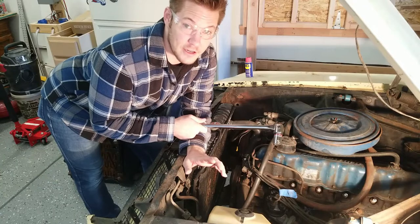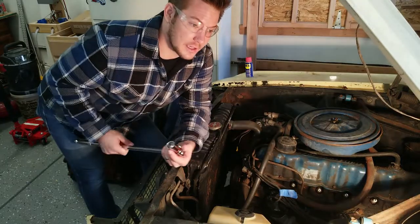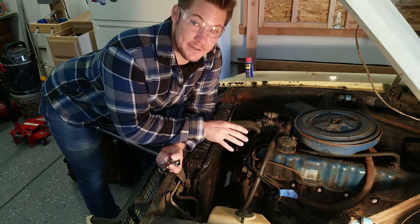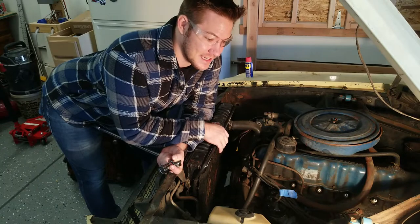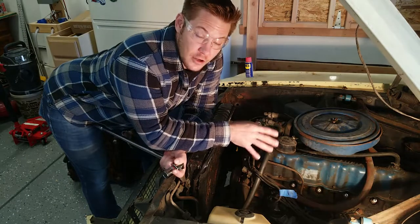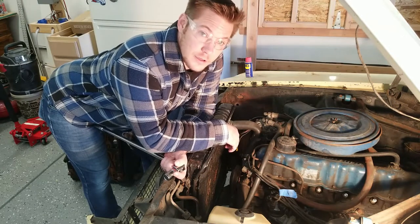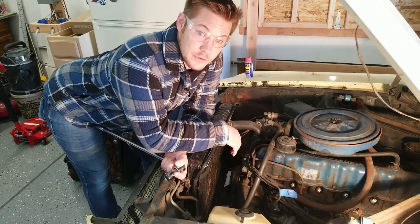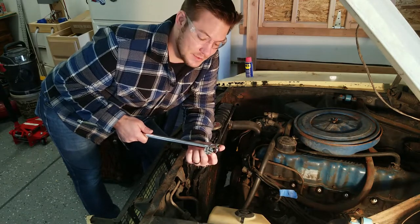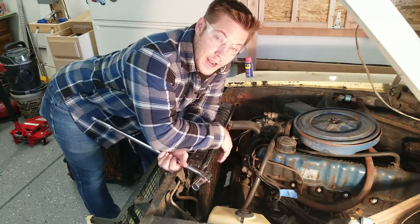So we got the fan out. Now we're going to try and see if we can get the main crank to turn over and free up these cylinders. On the 1968 Mustang straight six, the main crank bolt is a 13/16 bolt size. I highly recommend you get a 13/16 socket because it is used quite a bit on this vehicle — it's the same socket size for the spark plugs and also the same size used to remove the seatbelts from the subframe. We're going to give this a shot. You're going to want a stubby socket, not a deep socket, because otherwise it will not fit between the radiator and the main crank bolt.